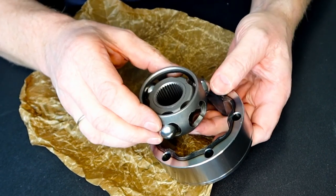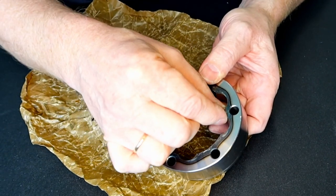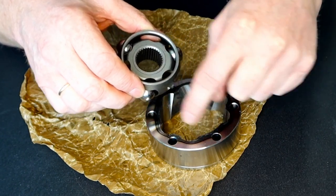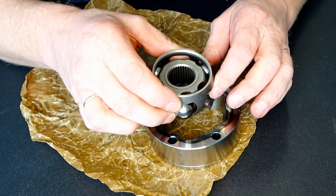Here is one important thing: you see they have a narrow and a wide spacing. The narrow goes against the wide, wide goes against narrow every other time. If not, you will end up with a very stiff joint — you cannot move it at all.